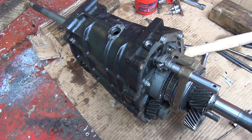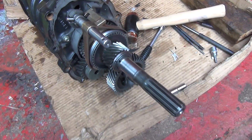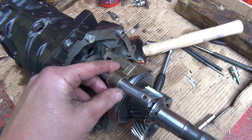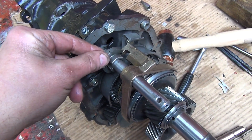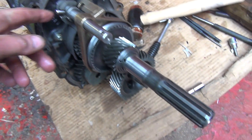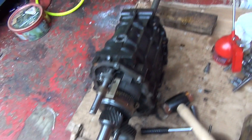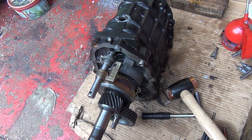So this is where I'm at. I've got the back case on, extension case, main case — whatever you want to call it — the rest of it is assembled. I've got it locked in two gears here and I've also gone for a fifth gear lock as well. You can manipulate these at the moment, take them out of gear and mess around with them, then put them back in and align everything when you need to at the end. This is just so I can put the tab nut on here — which I'm waiting for, hopefully coming this afternoon — and with the casing on it keeps all the gears aligned and locked together so you can tighten that nut as hard as you possibly can.